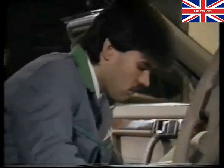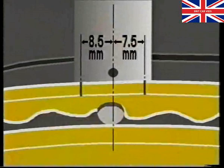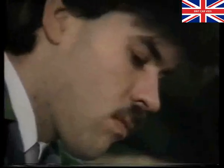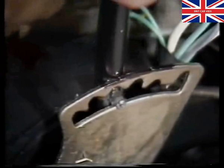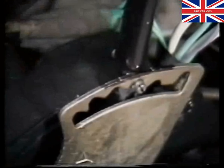Centre punch the lever in the middle, just above the quadrant. Then make two marks on the quadrant itself, one either side of the lever, to these precise measurements. Apply both the foot and hand brakes and start the engine. Move the selector lever forwards until you feel the first point of engagement — the punch mark on the lever should align exactly with the mark on the quadrant. Then move the selector rearwards; engagement should take place when the centre punch mark on the lever is aligned with the other mark. If either point of engagement is wrong, the cable must be readjusted. When the console is refitted, carry out a hydraulic engagement check using the gauge as before.